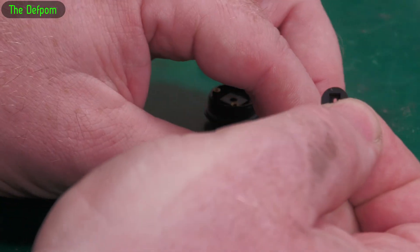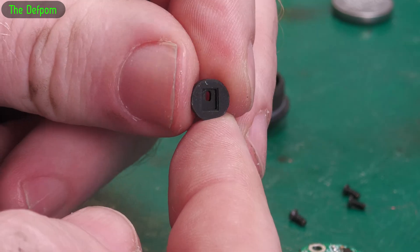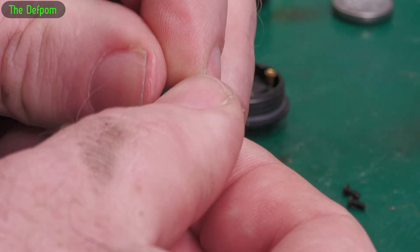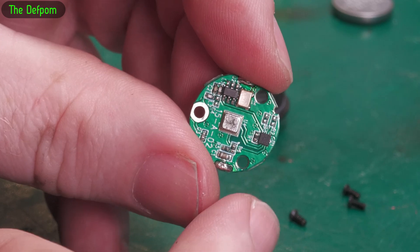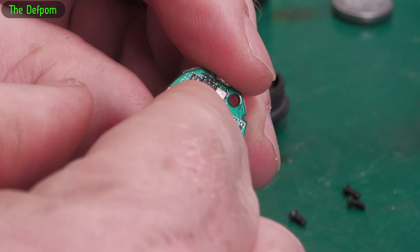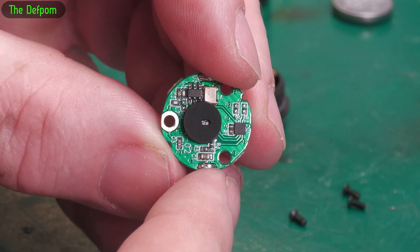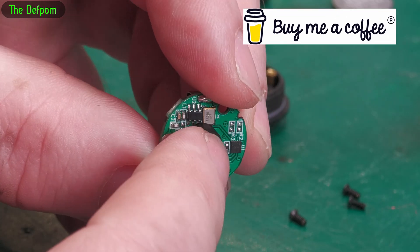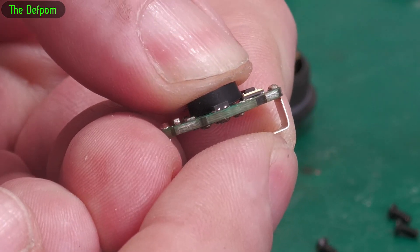It's got this little rubber boot here — excuse the dirt on my hands because I've taken the thing off the tire. There's a little cutout there in this little seal, and that sits over the sensor. The sensor has an offset hole, so make sure those match up. And that will sit on there like so. You can see the hole in the center, but it's sitting on top of this crystal here.